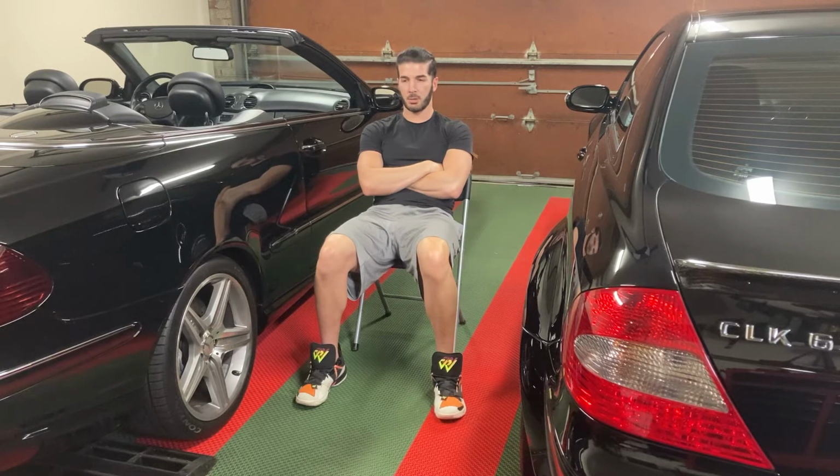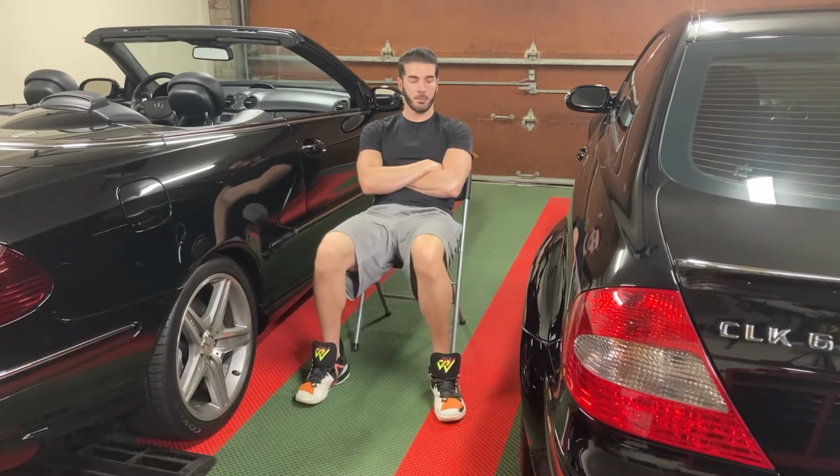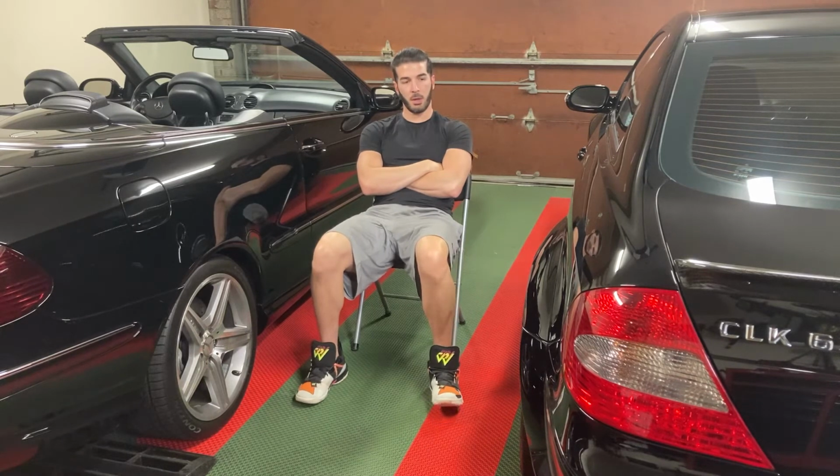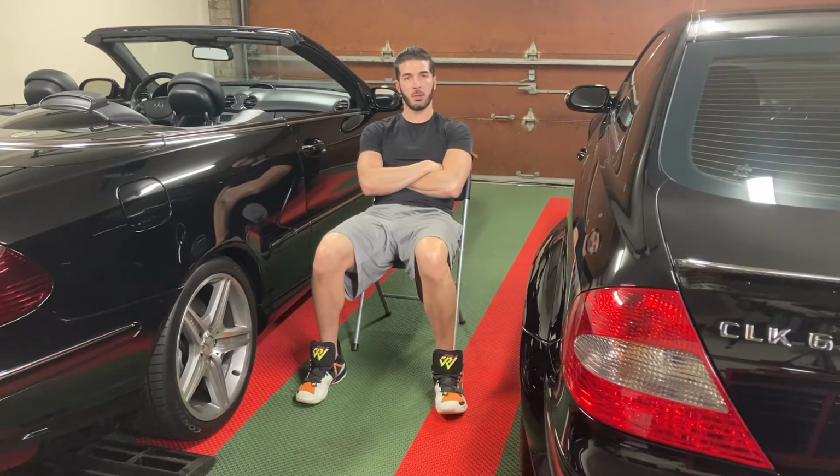And I understand, because the people who did my metal work, they're a race shop, and they were more about the functionality than the look. So when they ended up welding my fenders up, it went too hot and ended up warping the metal a little bit. Not enough for them to notice, but enough for the body shop doing the paint to notice. So they had to rework the metal a little.